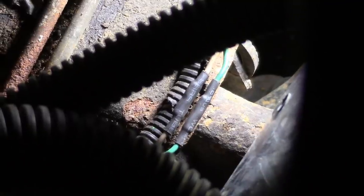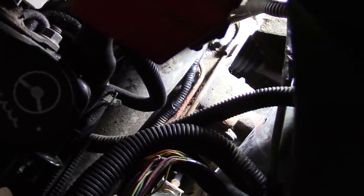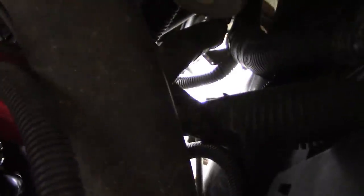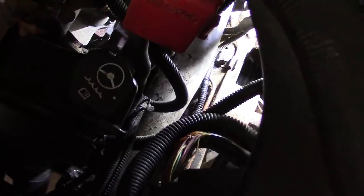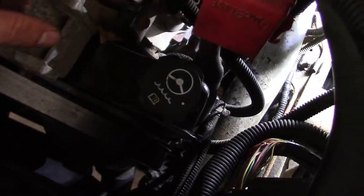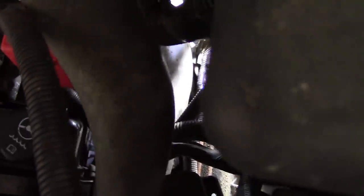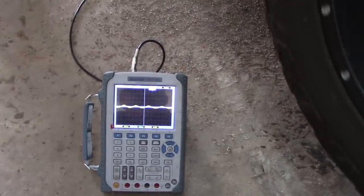I used my non-insulated butt connectors and then the adhesive lined shrink tube — that's my preferred method. Looks good — taped it up, reattached it to the little push nail anchor, clipped it back in. I don't have an explanation for how that wire got damaged. This coolant tube is pretty far away from the harness. He said he had the hydro boost replaced at one point, so maybe they got into it trying to get one of the power steering lines off. I really don't know. I think that's the only problem — let's do a little testing. That's what we want to see.